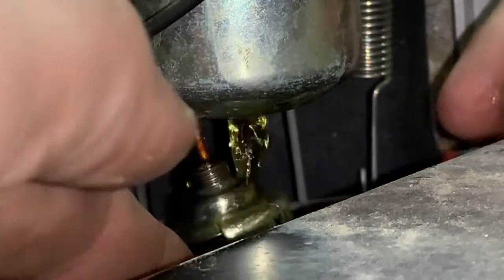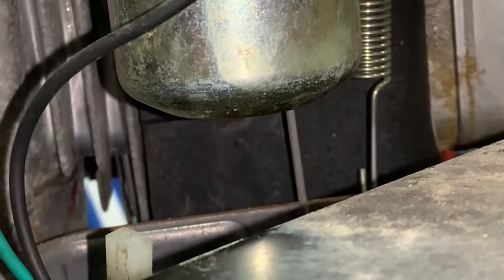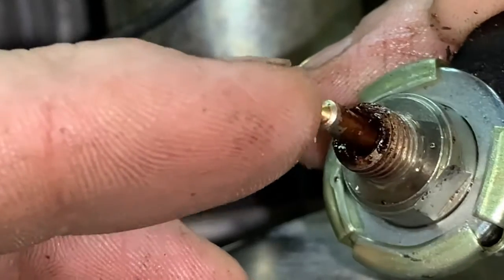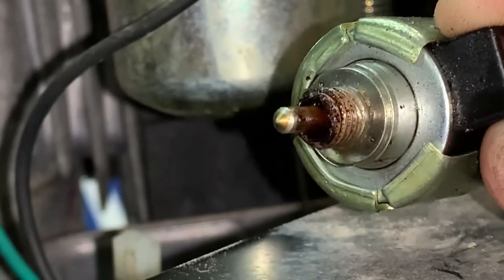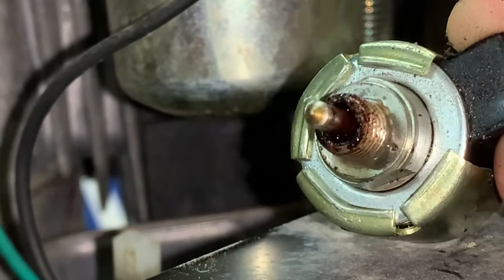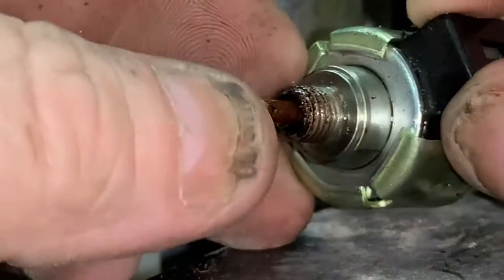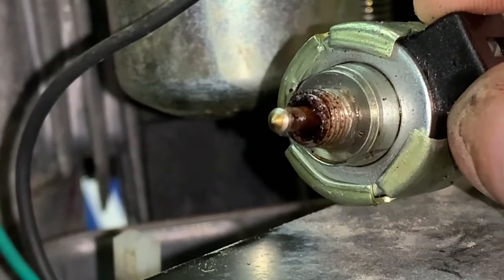I have a feeling this thing is just full of rotten gas. Oh man, how nasty is that. See what I mean by how this is the lowest point on that carburetor — all of that fuel will just sit right down in here and just gum up this fuel solenoid. Now this is probably 99% of the problems, but if it's this bad, you're going to have to pull that carburetor off and give it a good cleaning. There's no way you could just replace this. You could clean it out with some carb spray, but in my experience, as soon as that carb spray dries, it's right back to a hard-as-a-rock, gummy, no-good solenoid.